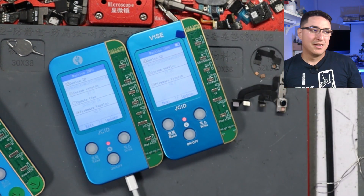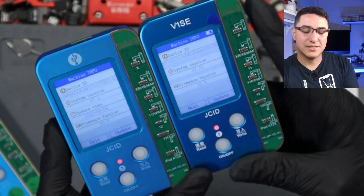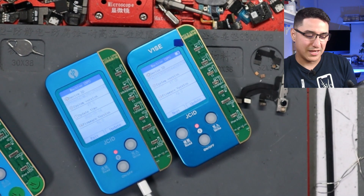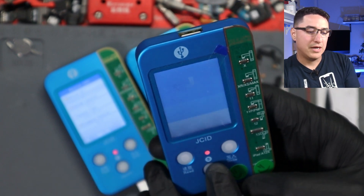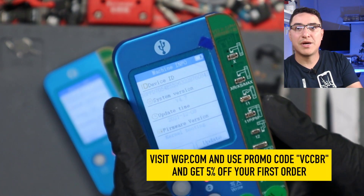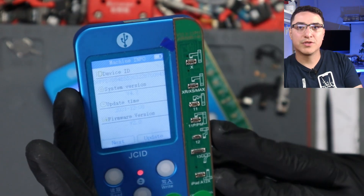The main issue is that the JC Repair System software just automatically updates your device — it doesn't ask if you want to update, approve it or deny it. It just updates it. And the problem is there's a bug in the newer software. You literally can't do anything — you can't downgrade it because the firmware is not out there for you to download and manually install. So you have to find a seller that has a device with the older firmware, like Wholesale Gadget Parts, at least for the time being until JC resolves the issue on their end.